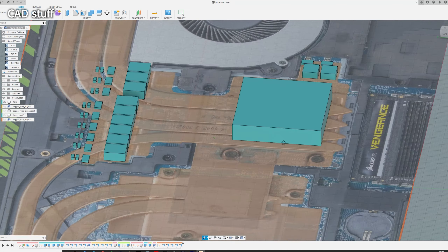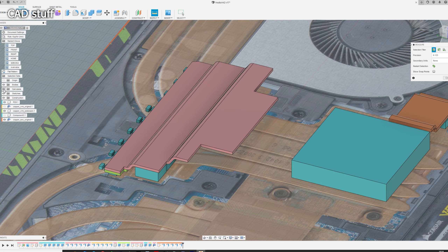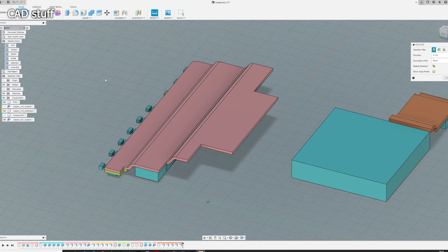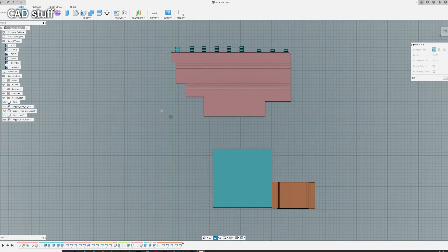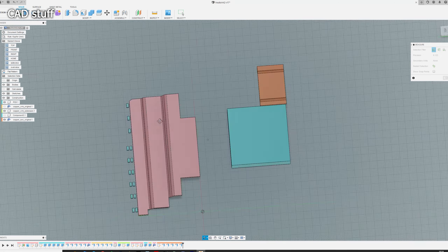The reason is that I planned to use a 1mm copper sheet instead of the original 0.8mm one, and I have no proper sheet metal press to build up enough force to bend the sheet metal to a nice 90-degree stair-shaped coldplate as seen with the stock heatsink. So my only solution was to use a second layer of 1mm copper sheets to make the lower part 2mm thick in total and come closer to the VRM's power stage this way. I also increased the size of the lower part so I can cool down the closest ceramic capacitors with the heatsink too, with the goal to transport a little more heat away from that area in total.